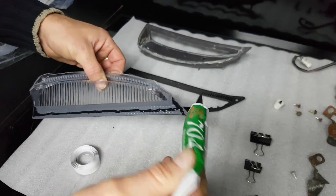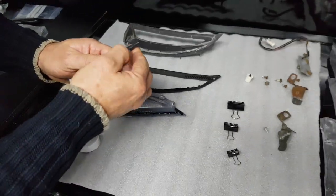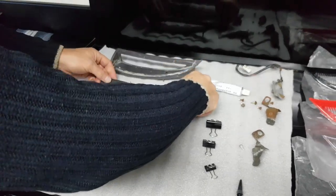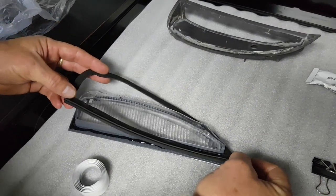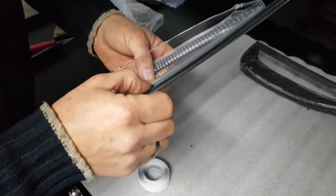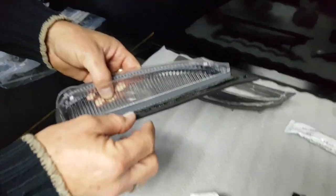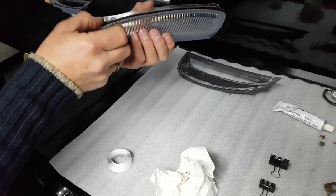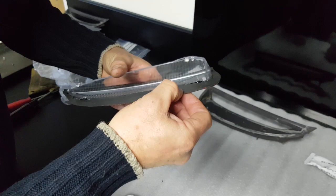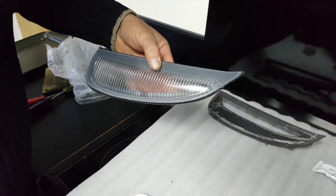Once we've got a good end-to-end coating — perhaps put a little bit more on the end because you've got quite a lot of rubber to cover there — put the lid back on so it doesn't start hardening. Now we grab our rubber gasket and gently drop that over the top. This one I did manage to get fairly supple again. We're going to position it exactly where it needs to be and let's just hope it will all go into place. This stuff is fairly slow drying so once we've got it all together I'm going to clean up any overspill to tidy up the job.